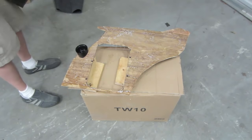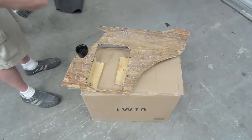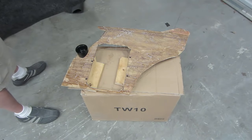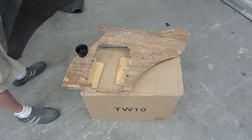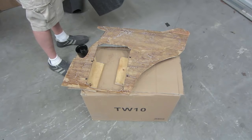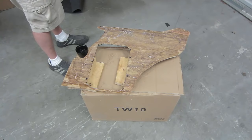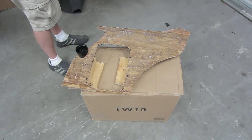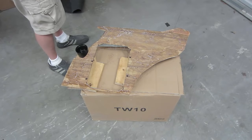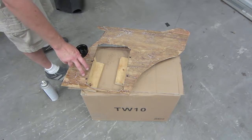You're going to want to spray this pretty liberally — try to keep this stuff off yourself, by the way. As far as this trunk liner goes, believe it or not there's a side which actually is the side you're going to use, and there's a back side, so be very careful that you spray glue the correct half. That would be a shame if you did the wrong side, especially if you only had enough just to do the job. You're also going to want to spray the other part which is going to make contact with it — it's very important because you're going to lose almost half of your adhesion if you don't do this step. A lot of people don't even realize that. They just spray one side and stick it on there expecting it to stick well, then when it starts looking all funny in a few months, that's why. Give it a minute or so to set up — when you know it's set up it'll feel real tacky, almost stringy.